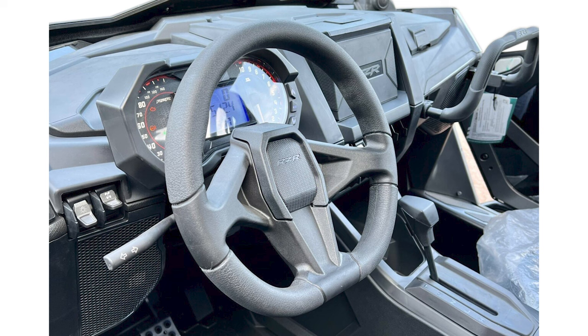Today we are installing a DRT steering wheel adapter and steering wheel on a Polaris Pro XP four-door model. This is the style wheel for this model, but there are different wheels depending on the year and model. Please do a quick search for the steering wheel removal process for your specific vehicle. This model's steering wheel has a bolt-on center cap you access from the back side of the wheel. Note: do not use a screwdriver or body clip tool to remove it or it will break.